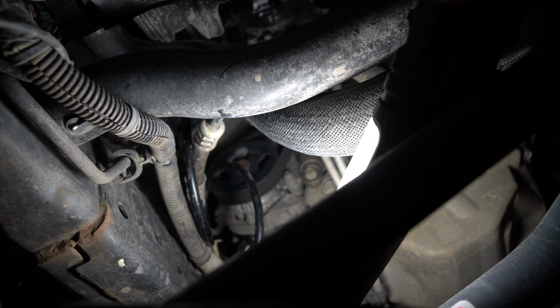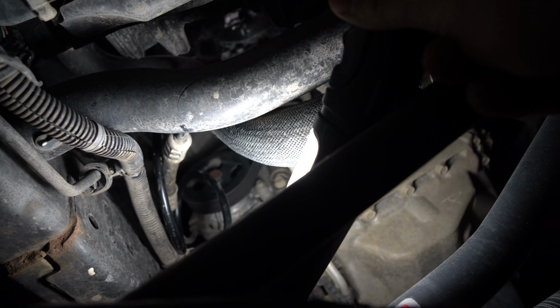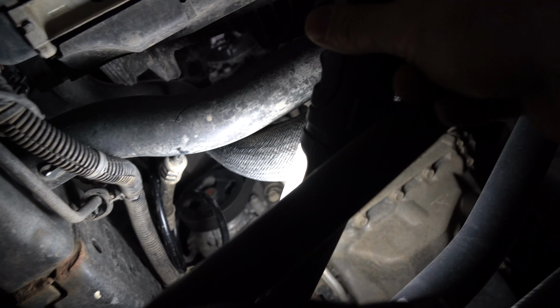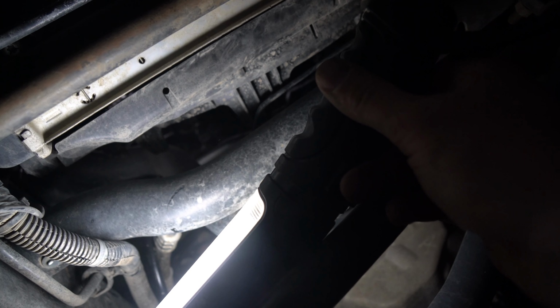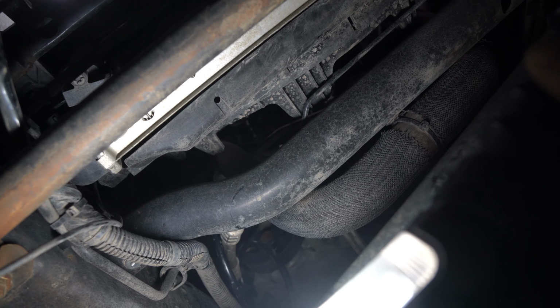You don't want electrical to meet the pulley, because if it pulls it out, then you don't have a winch anymore, or well, any winch power, and it might do other things. So you don't want to do that. Whatever you do, zap strap it away from the pulley. Make sure you don't zap strap it to any radiator pipes. And that's basically it. After I get this fully zap strapped and cleaned up, I will show you better, because I'll have the red wire to show you.